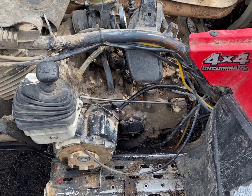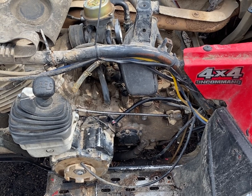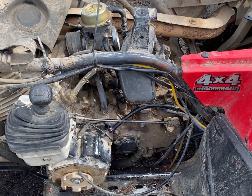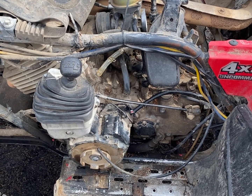The other option would be a bad wiring harness. I jumped the wire coming right out of the CDI all the way to the coil, and I'm not getting any signal when I use my voltmeter right at the CDI. So it's got to be something in the stator, and I'm at a loss. I'm going to open it up and see what's going on.